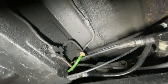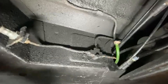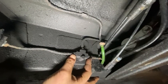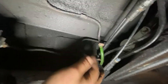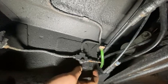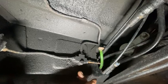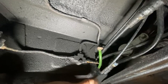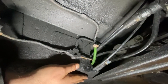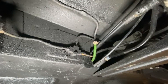This here is your brake line, and I believe this is just a sort of union that pushes the brake lines to go in different directions. You can see it's very corroded, so I've bought some galvanized ones to go on there - I just need to bend them all into place. On this one it's got underseal on it, which is great for protecting the body, but they've kind of just sprayed it on everything.